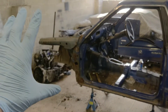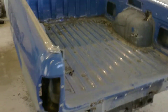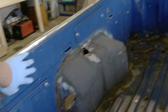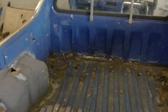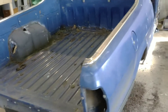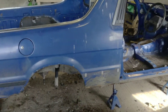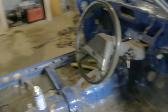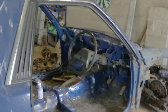The brat is pretty much going to be turned into a tube frame car now. I'm going to retain basically the rear quarter section and the cab section — I've already cut the front off. The whole rear section of the bed is going to be cut out along the body line. We'll be boxing in the rear cab section to make it fireproof and safe. All of the bed itself is coming out, wheel arches and all — that'll be cut out and exposed. There's quite a large hole in the floor here and both rear sections have holes in the corners.